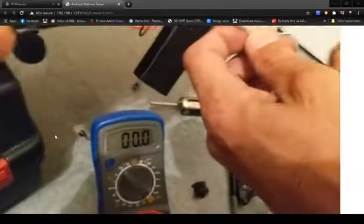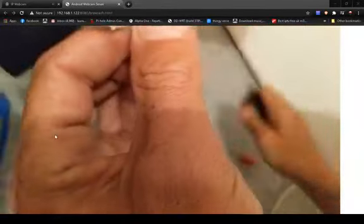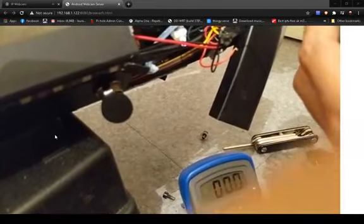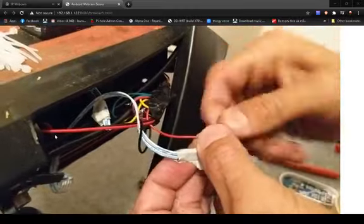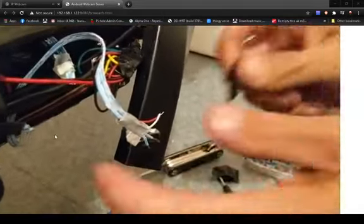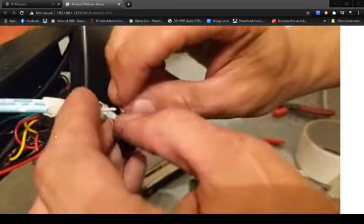So what's the next one? And then we do the same for the other side. And then we can just twist wires to pick a colour. While I'm here, let's strip them. So we know green now. Let's isolate green, so we don't touch nothing. So that's green out the way. Let's go back to the positive. It's basically process of elimination. So isolate that again. And all we need to know is what this colour is, and then we know the next one, because of RGB: red, green, blue. That makes it easier.